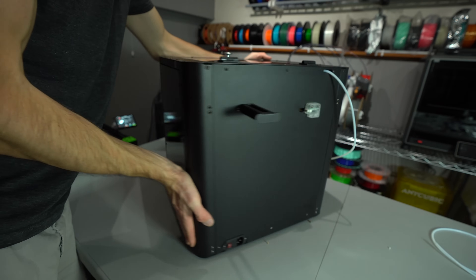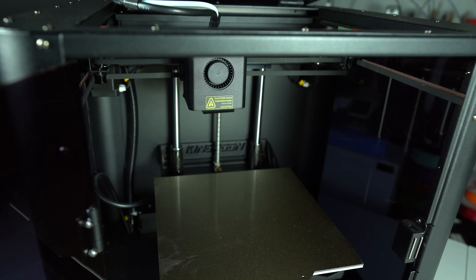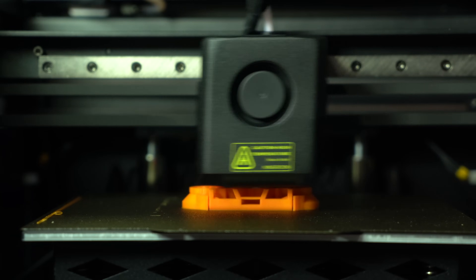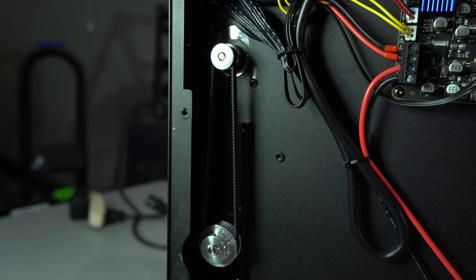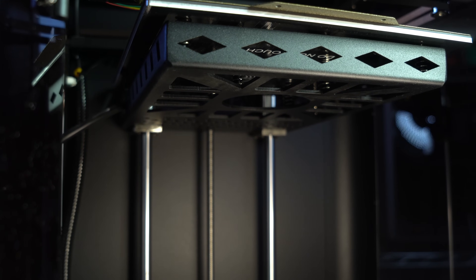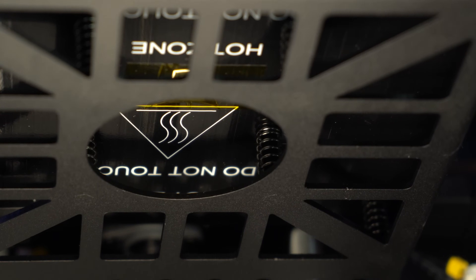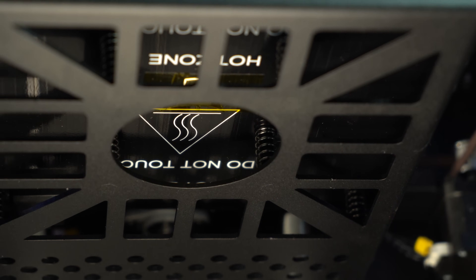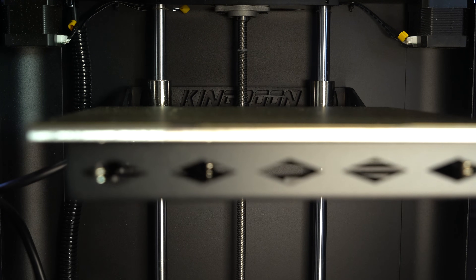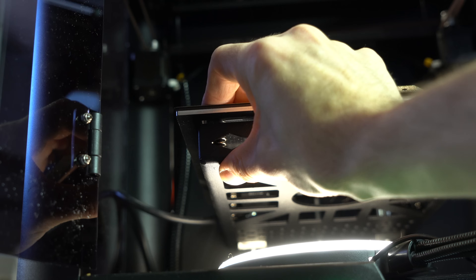The KLP1 is a fully enclosed printer with CoreXY kinematics. It has 210mm of build volume on all axes. Linear rails are used for motion on X and Y. The Z-axis is lead screw driven with a 2-to-1 gear reduction for increased torque. The build platform is cantilevered and rides on two half-inch smooth rods. Underneath we can see a PCB-style heater with a maximum temperature of 100 degrees Celsius. The bed itself is an eighth-of-an-inch slab of aluminum with a magnetic sticker on top, and is spring loaded with eight points of adjustment. It's factory leveled, so we shouldn't need to touch them.